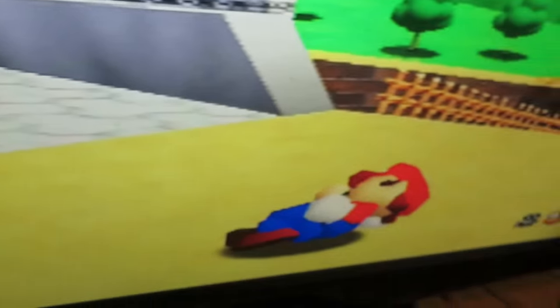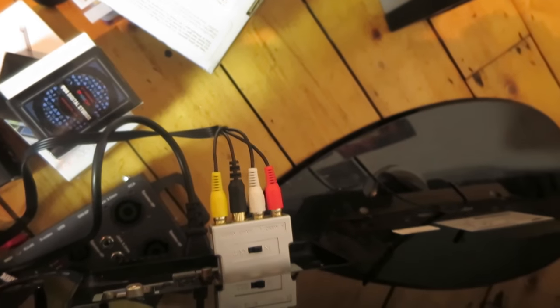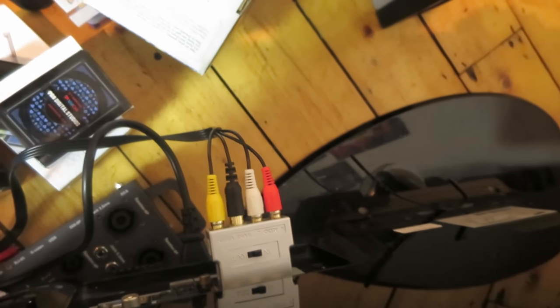This is so weird, and I don't understand what the hell is going on. I believe it's something to do with the SCART adapter. Well, it's blatantly something to do with the adapter, but the way this works confuses the hell out of me. Basically, all I did then was plug in the composite as well as the S-video into the SCART adapter. So now all four connections are plugged into the adapter. As you can see, that has now pretty much got rid of the effect.